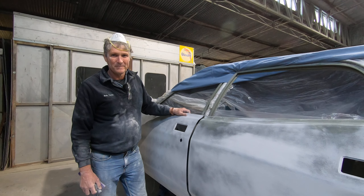Tomorrow arvo I'll have all this through into final primer, then I'll probably leave this car for three or four weeks to sit in primer and harden up. Dave's a pretty fussy bloke and we want this to be a really nice job. If it wants to have any shrinkage that'll all be done and out of the way, and when we block it down for colour we know it's going to be a very stable paint job that'll last for years. That's a little bit about spray poly — catch you next week, thanks guys.